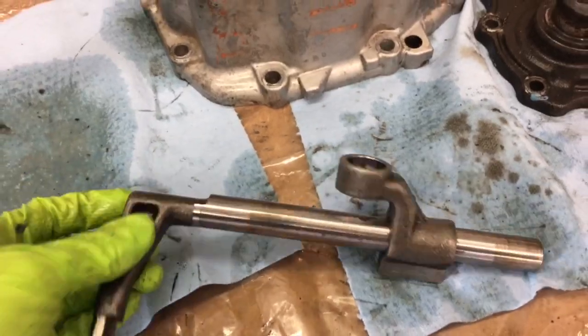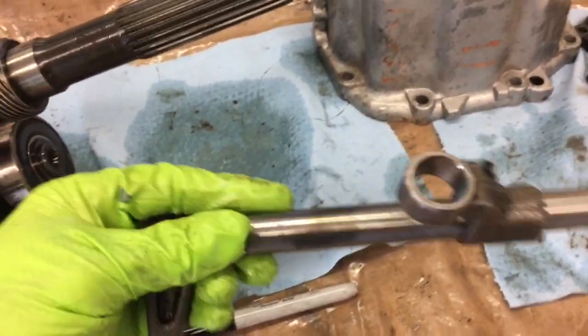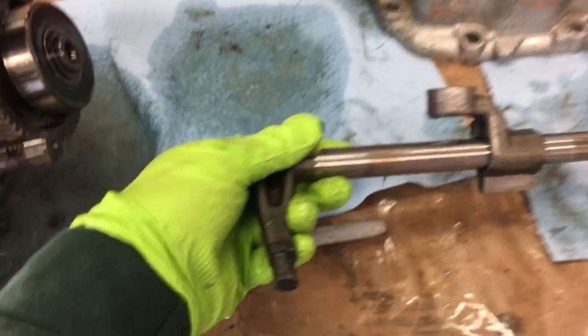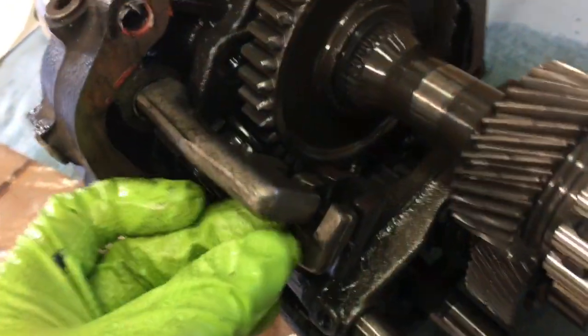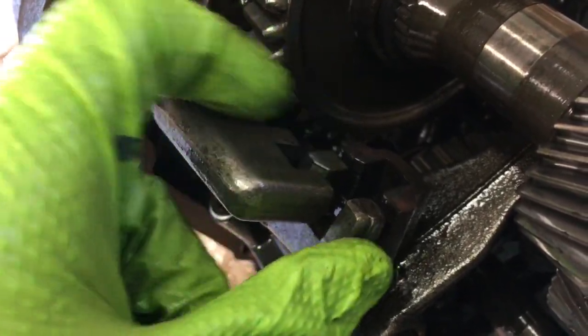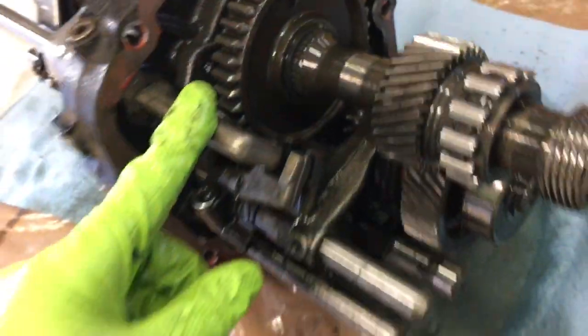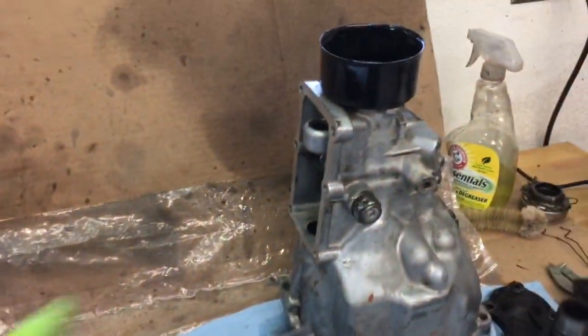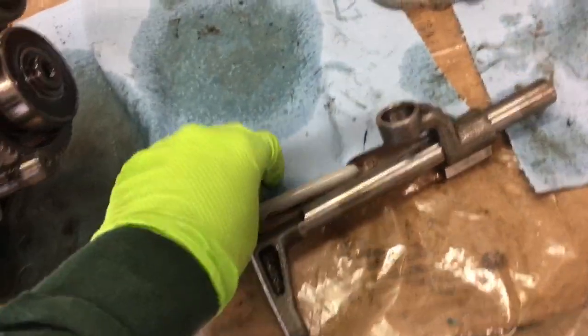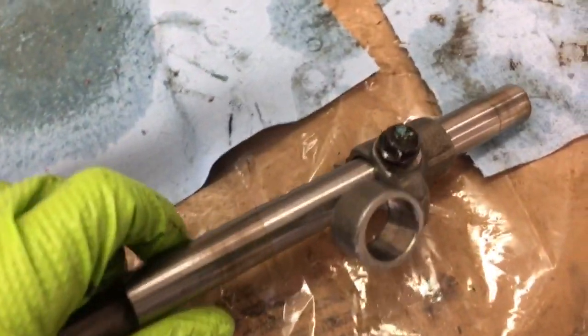On the back side it's a little more tricky. You have the shift linkage here — this is what's actuated when you move your shifter back and forth through first, second gear, and so on. This little knob goes into this little affair here. Right now I'm in second gear. Depending on how you actuate the lever and the pivot, that little foot moves these guys around. When you go to slide the back piece off, there are no spring clips, but this little piece here is holding up the show.